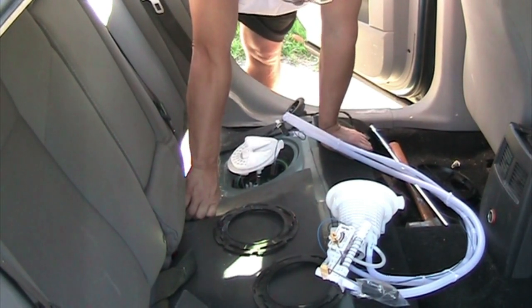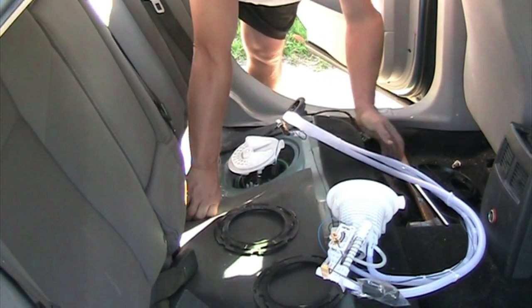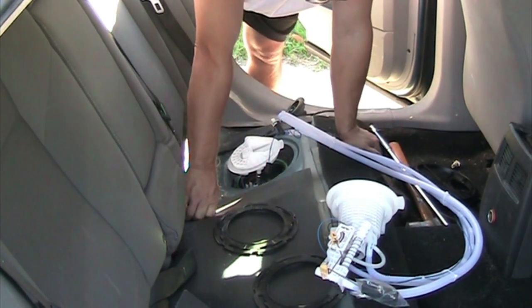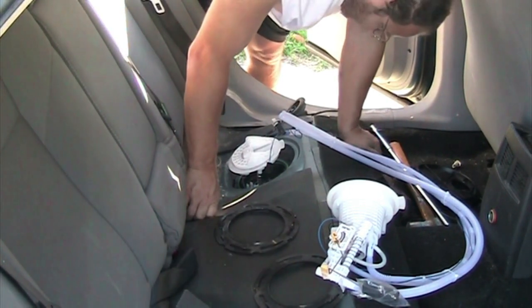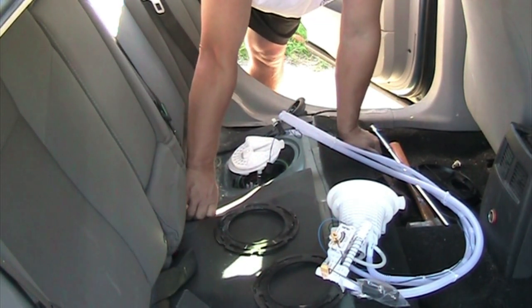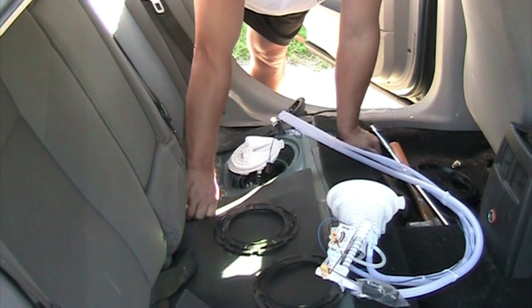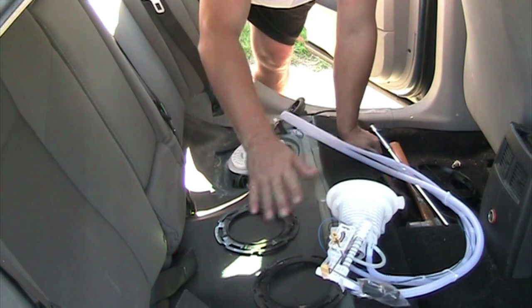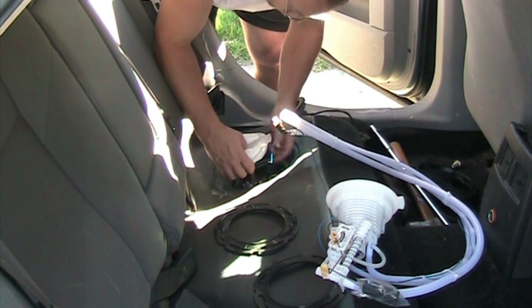It has to be pushed through the gasoline, but once we have that exchange the engine should start after the air is being evacuated and everything just fine. I believe that when we did the first initial exchange here, something started sucking air one way or the other. So we'll figure that out. I'll take out the filter unit over there — which is this one here — in a second, once I have all these fuel lines here disconnected. And you can put a little hose to it. As you can see, I just pulled with two fingers these two hoses off, because they are just clamped in — there's nothing holding it other than a plastic clamp on the side.